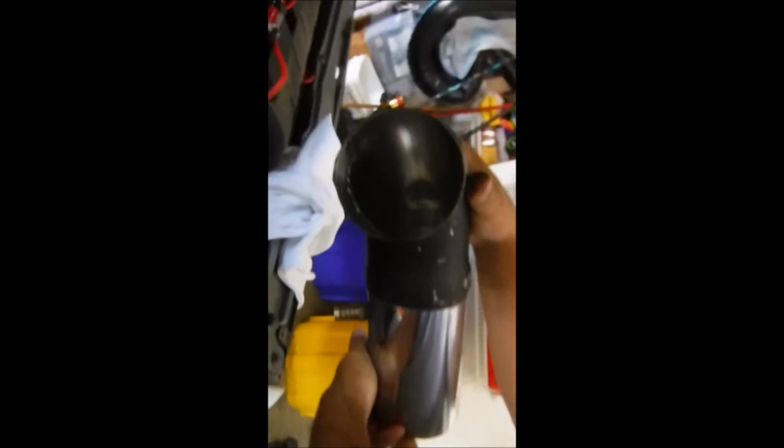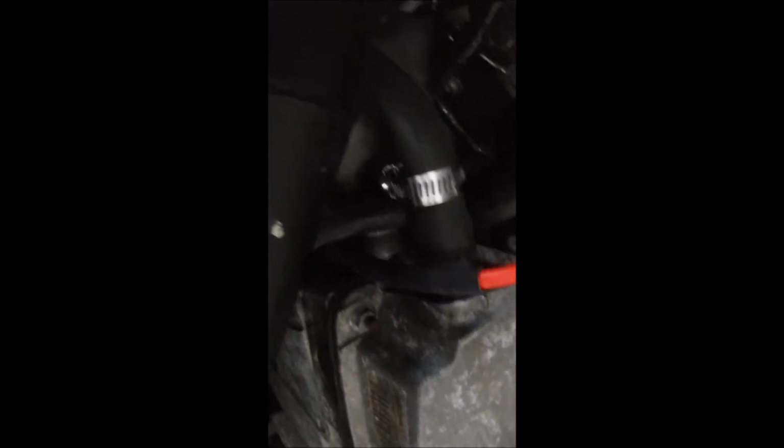That was the 4-inch inlet that attaches to the turbo. This was for the oil breather. And that's pretty much it. Stuff out over here. And now you can kind of see the turbo. Where? Oh, right there. Which is right back there. And that looks like a T70 turbo. Which is, you know, nothing big. But for the VR6, it should be more than enough to handle at least 400 to 500 horsepower.